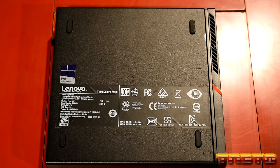So we got our total 32 gig of RAM. So it sees our 32 gig DDR4. JEDEC manufacturer 1315, doesn't really show anything else. Shows what it's running at, 2133, that's correct. Shows the part number and serial numbers, origin. So it doesn't report Crucial. We got our motherboard information.